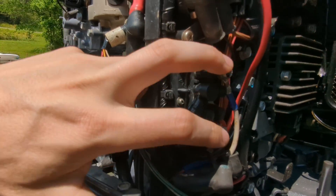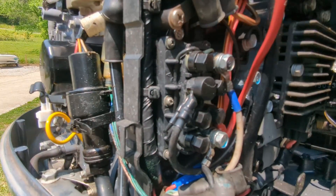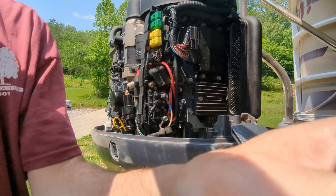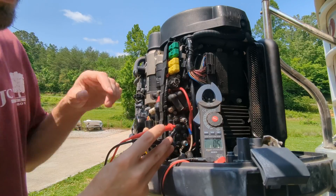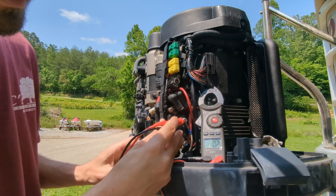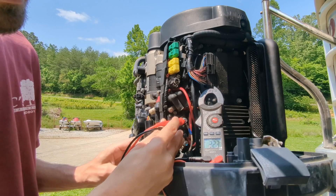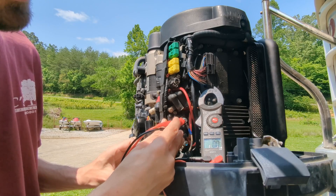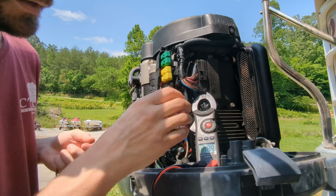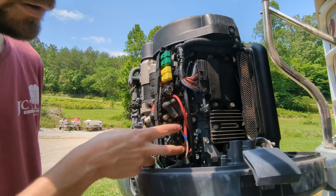What we're going to do is put our multimeter on these two outermost ones right here, and push the up button and see if we get 12 volts. With our multimeter set to DC volts, we connect right there, and you see it's zero. Push the up button — still zero. It fidgets around a little bit, but if we push down, 10.8 volts, which sounds about right given that it's running the trim motor and the engine isn't running. So that proves to us this relay is not working properly.